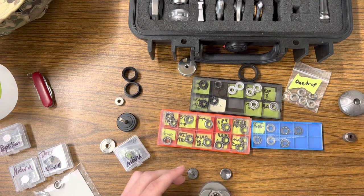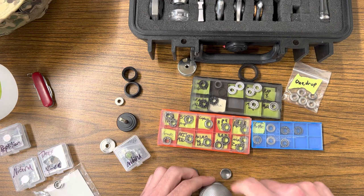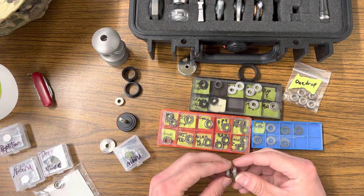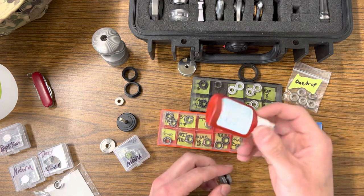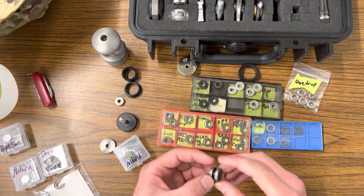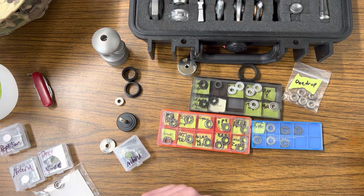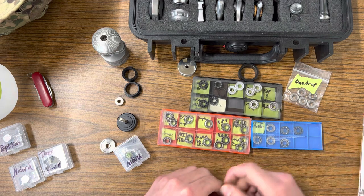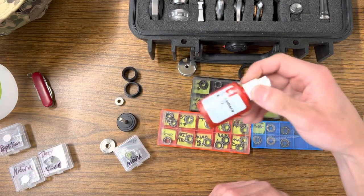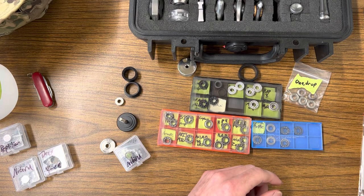Something I've found with the torque bars - maybe the tolerances aren't quite as tight as some other spinners. I was able to just press it right in. Loctite sets up in the absence of oxygen, so if there's not a perfectly tight seal it's going to cure slower. I'm not going to sit here and reinstall again - hopefully it'll dry. It could take a little bit. Maybe a little slow for some spinners but I still love it - it's still my preferred method. Easy cleanup and it sets up pretty quickly. I'm not changing bearings that much anymore nowadays.